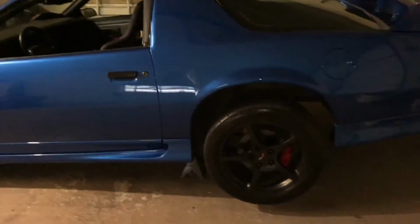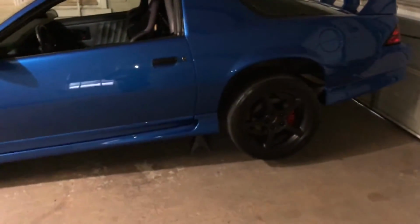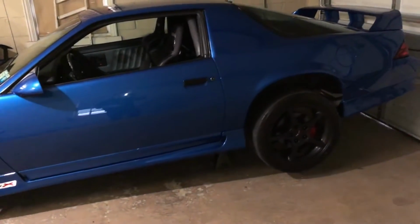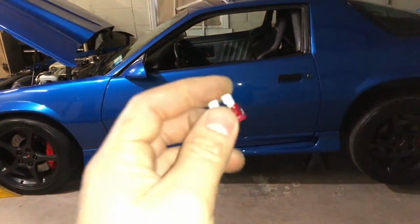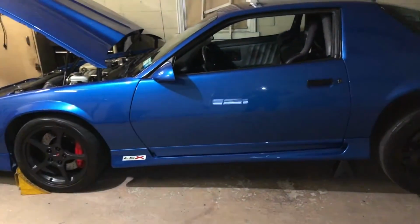Get a little video out for you guys, just if you run into this problem with your car, you know how to check for power at the pump, hit it with the probe, and then do the obvious easy stuff, check the fuses, which turned out to be a simple problem this time.